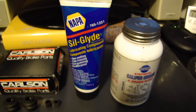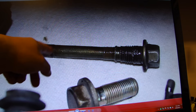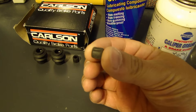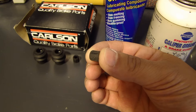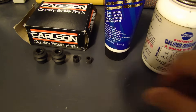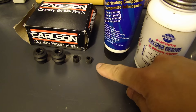I still use this; however, when I apply this stuff onto the slide pin and coat that end, after a number of years the bushing at the end — and I have a new one here — the bushing actually started swelling. It got to a point where I was able to remove it but could not get the bolt or the slide pin to slide back in. That's because a lot of brake grease out there will swell up that rubber.